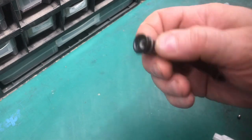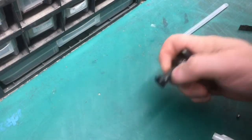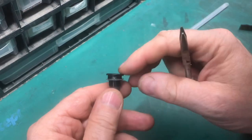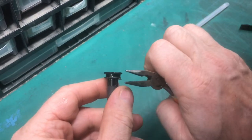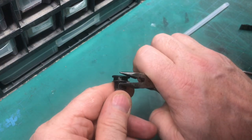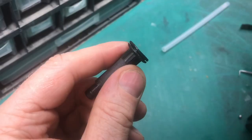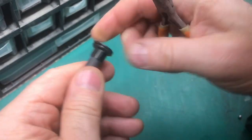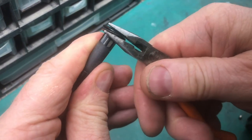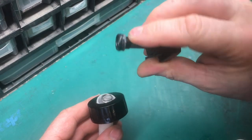Make sure the plunger is flattened as much as possible. Take it on a flat surface and press on it to make it as flat as possible. We'll reshape this upper portion of the flange with a pair of pliers — just be careful not to cut or damage this flexible piece. This is what that plunger's supposed to look like when it's reformed.